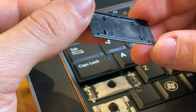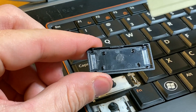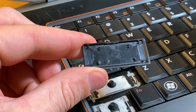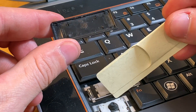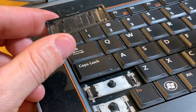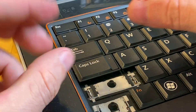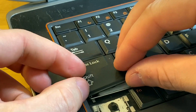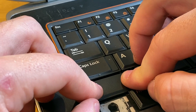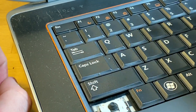What you're left with is a scissor that freely goes up and down. On the back of this key we've got four attachment points which coincide with the scissor, and then you've also got the spot for the metal bar. I like to put the metal bar about halfway down on the riser, then kind of put it down, put the shift key down, feel where it will stop, and once you've found it just push it down — and now that key is fully functional.